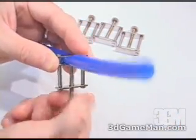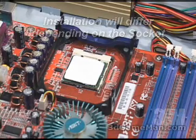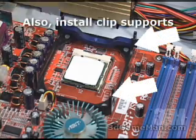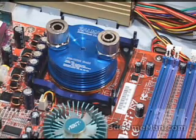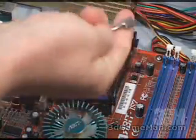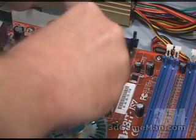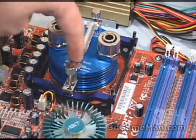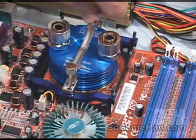Installing the CPU water block is quite simple. Slip in your CPU and apply some thermal compound. Place the CPU water block on top. Next there's this clip, and finally two hand screws — these go on the inner part of the clip and down through the clip at the top into the clip support right here. Screw them all the way down.